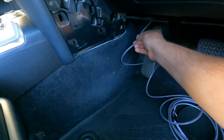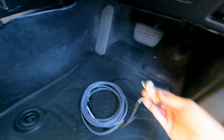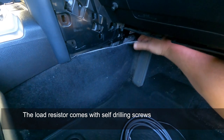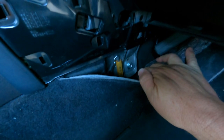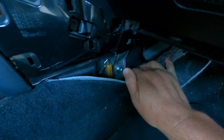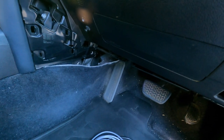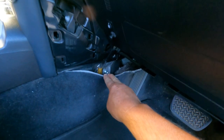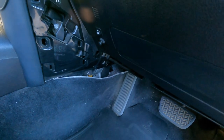This is the harness to the ECU that goes into the control module. This cable essentially just goes in through here, out the other side of the transmission tunnel, and eventually goes up through the firewall to the engine bay. The resistor is mounted onto a bit of metal — you pull back the carpet, you see the control unit's already installed there. You can just drill the resistor onto a metal surface here. It doesn't get very hot. The design of the unit is such that it'll switch control of the solenoid back to the factory computer whenever it wants to drive it.